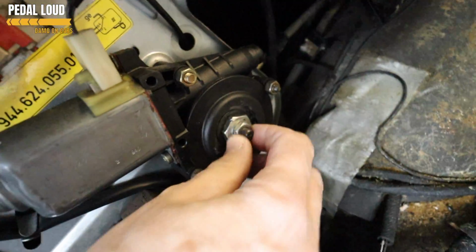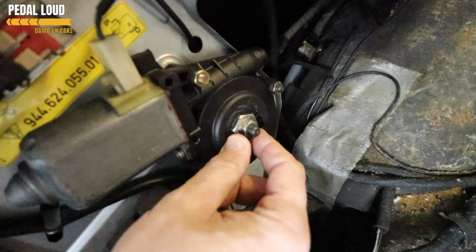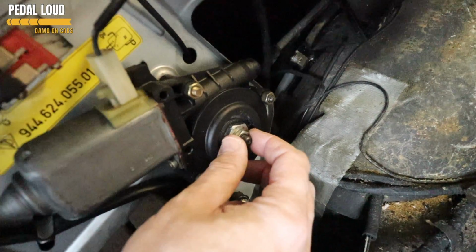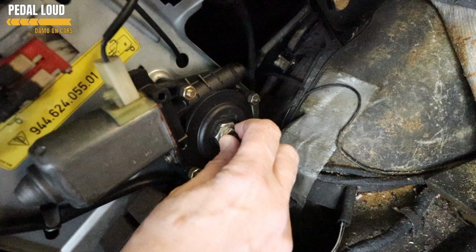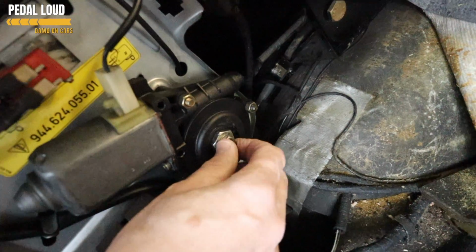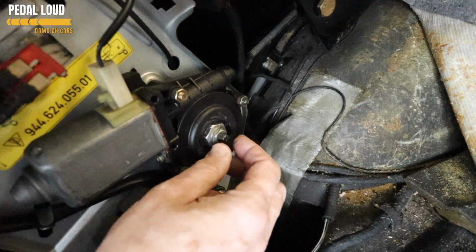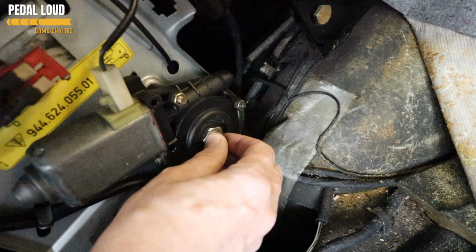And then what you need to do is go round, move your key to the accessory position, and push it as if you're retracting those arms. Now you've got the brass ones, you're in a safer position. You're not going to strip those cogs. It's really dodgy, this, because if you've got new plastic ones, it's dead easy to strip them. So you loosen this off, and what should happen is, when you hit that, you'll hear the motor whir, and it should just stop, okay?